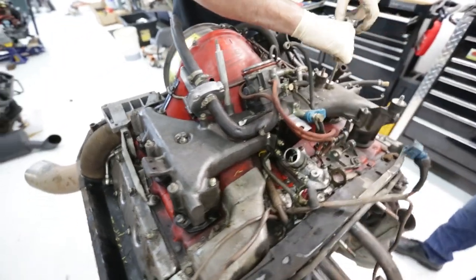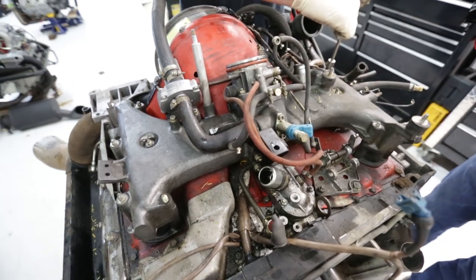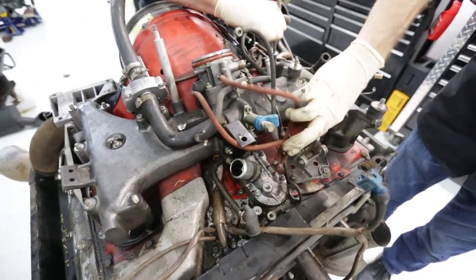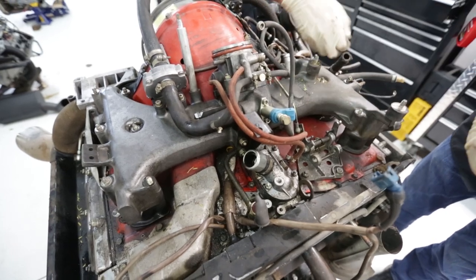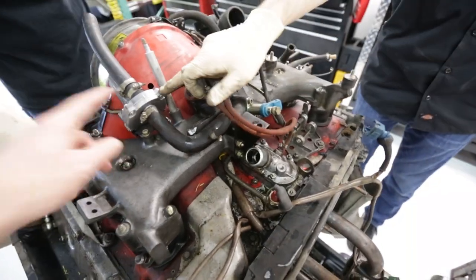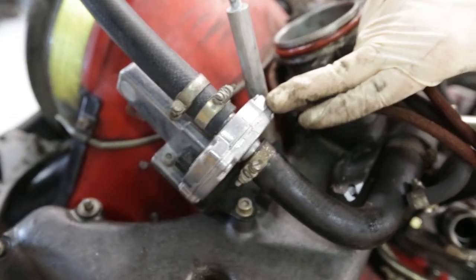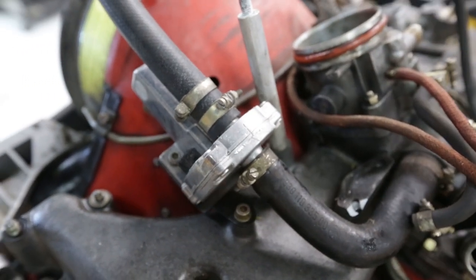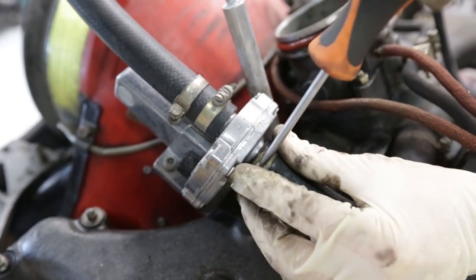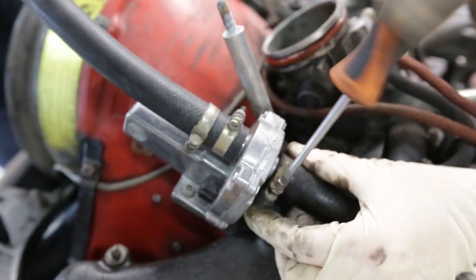So we're still retaining this manifold here. And the throttle body. And the throttle body, right. But stuff like these old fast thermo valve switches. Gone. Gone. Cold start valve, gone. This is a bimetallic spring operated auxiliary air regulator. It's a totally analog idle valve. For the common person, it is an idle valve. It's an analog idle valve, but it's now, of course, going to be a modern T-wire electronically controlled. Ooh, I like electronic.